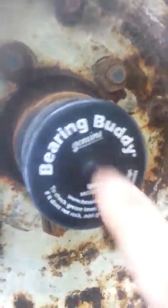Check for leaks on your hydraulic tanks if you're driving something that has hydraulics. Check your equipment — it won't take much, just a couple minutes a day. See this tire — there's no tread left on this, this has got to get changed. But this one's a hard rubber tire. If you don't know what hard rubber is, see there's a hole in it — it's not going to go flat. Have a nail in it — I got nailed. And you see there's bolts that hold the rim together, and these lug nuts hold the rim to this. Always carry spare fuel, if not for somebody, at least for yourself. You can also put bio in that.